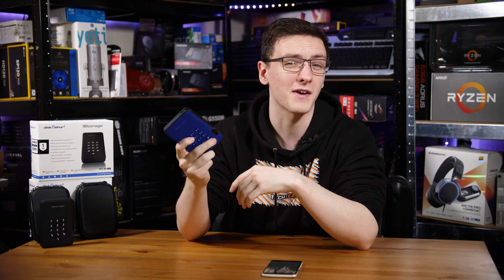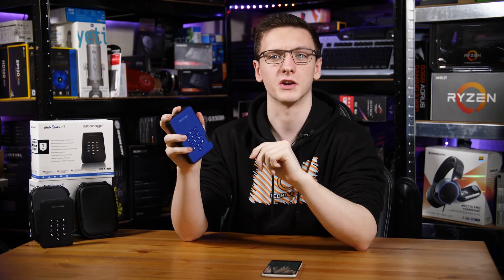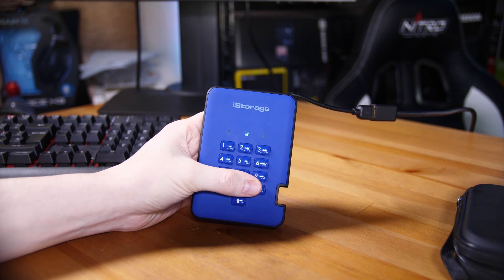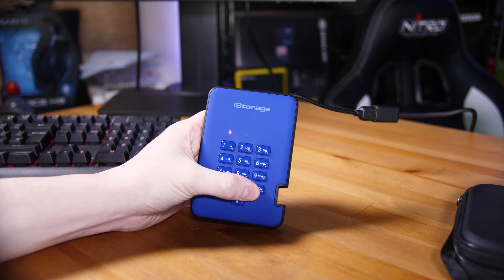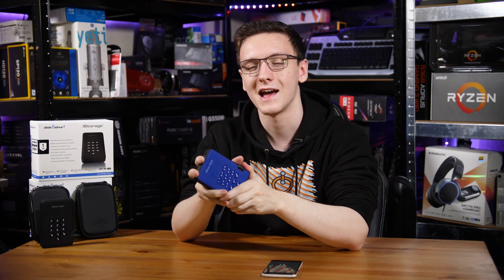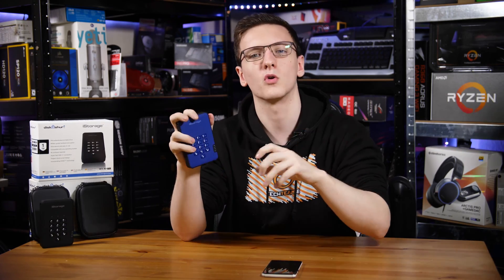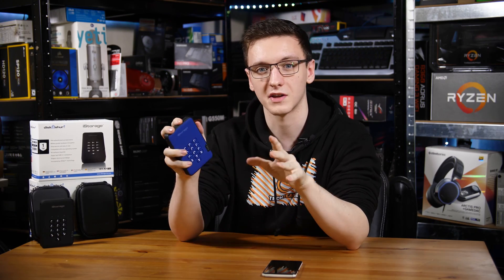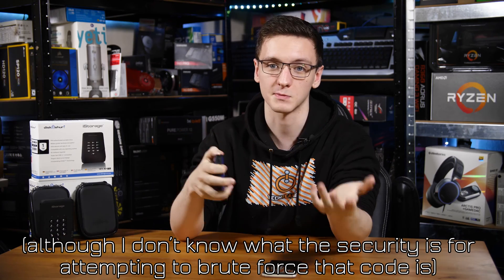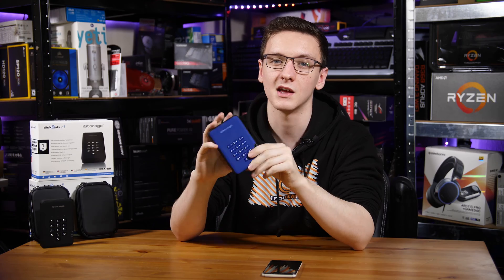If you did want to try and get at it, not only would you find an encrypted drive, but it's going to be a bit of a hassle to get down to the bare drive in the first place. There's also a self-destruct mode in two different configurations. The first is with a brute force attack - you can't just endlessly type in numbers and hope to find the admin or user password, as after five attempts the drive will hard lock itself until you unplug and replug it. You then get another five attempts, at which point it locks again. After unplugging and replugging, you'll need to enter a code saved in the user manual, which apparently only comes on the drive itself, giving you another five tries. If you don't know that special code hard-coded to the drive, it will just lock itself. But if you do know that code, after the 15th wrong attempt it will delete the admin code and the encryption key, rendering the drive useless.